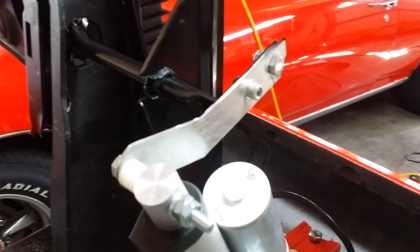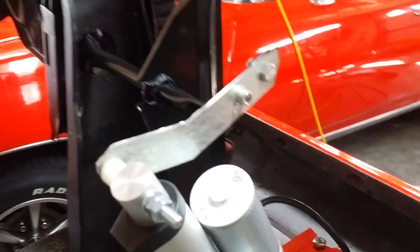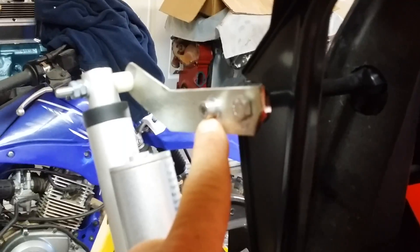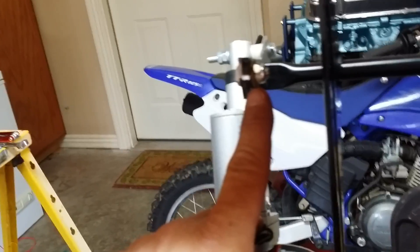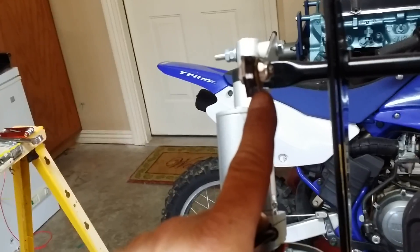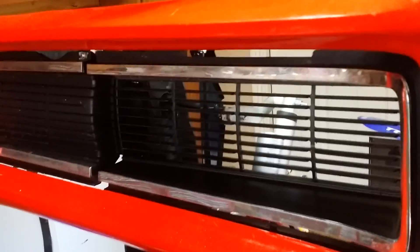The trickiest part is the arms — trying to get the right dimension without having any interference with the radiator or the front grills. Mounting to the actuator arms, the back bolt went ahead and did a real tight tolerance with no slop. And then on the actuator arms, you've got a square locating peg on the back here. I left that with a lot of slop, and I used a star washer backed by a flat washer, and that gives you pretty much infinite adjustment when you're trying to trim this out and make the lines meet the actual grills.